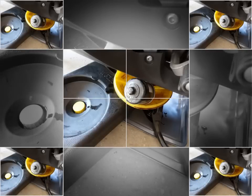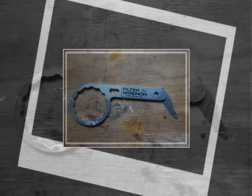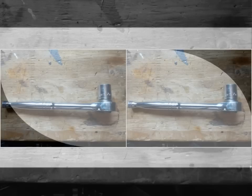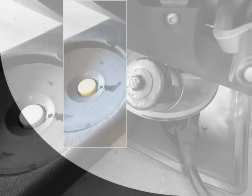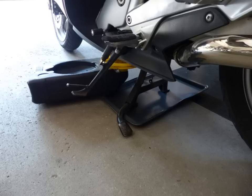There are a couple of shots of the different styles of filters that are available. If you have the one I unfortunately got this time, you need the Honda wrench, which is a bit of a pain. The K&N filter — this one I love — you just need a 17 millimeter socket and it makes it very easy.